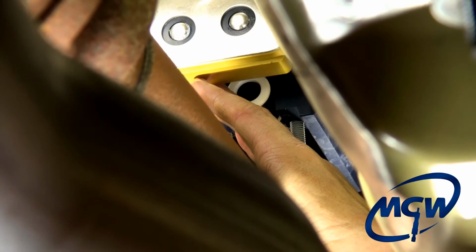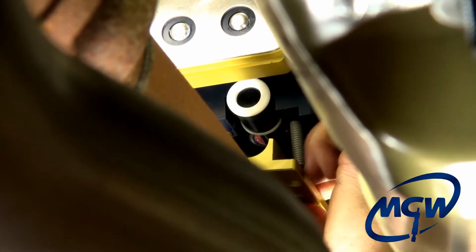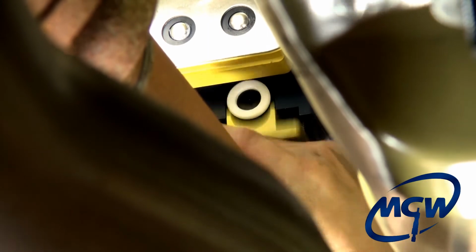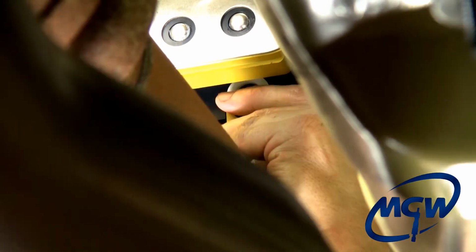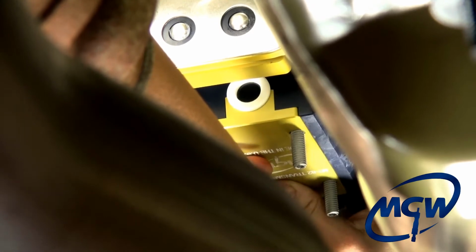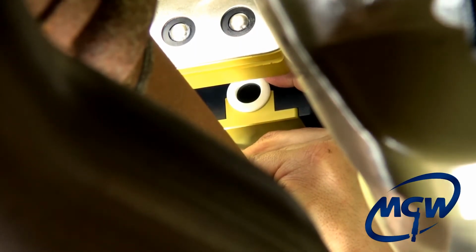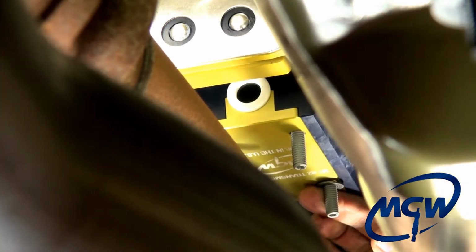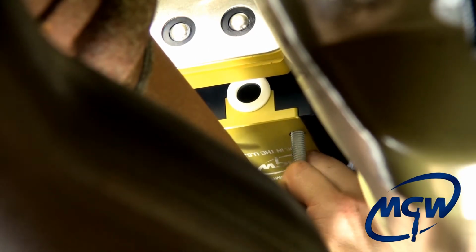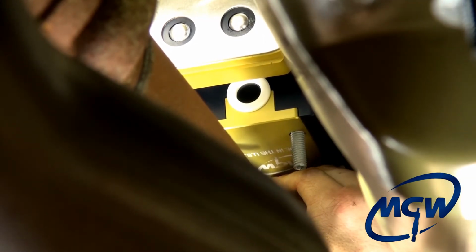Okay, and then you just want to kind of hold it in place with one hand, and you'll take your gold plate, you slide it up. There you go. You just hold it with one thumb and grab your smooth washer first. Hold that in place. And a split lock washer. And then one of your 5/16 armor coat lock nuts.